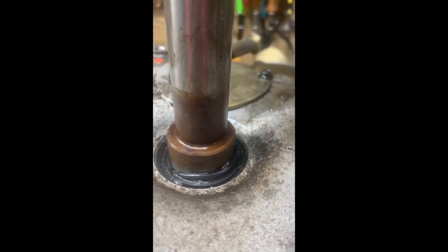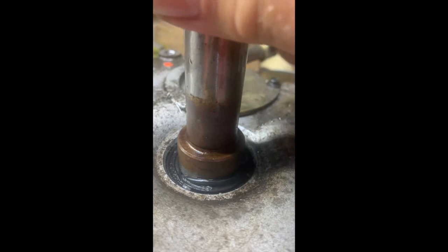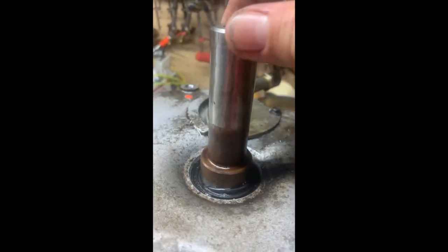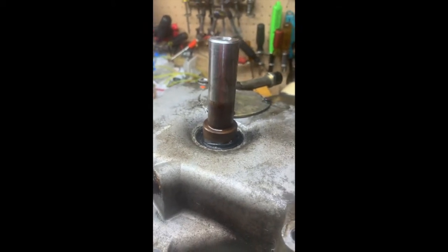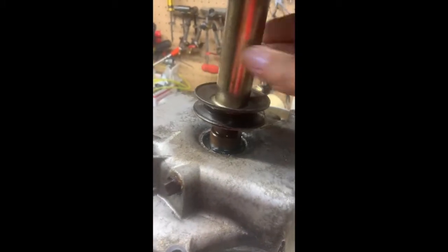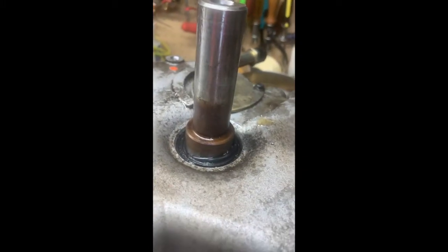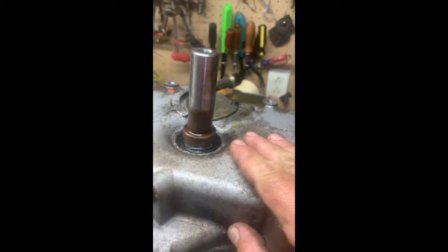When you put oil into your lawn tractor engine, there's an oil seal that goes around this shaft right here - this is called the crankshaft. The main pulley system goes on top of this crankshaft, and the pulley is what the belts go to when the mower is running. This pulley goes on top of the motor like this - there's a key on the shaft and it fits right to the engine. You can see this area is full of oil because it was leaking out of here. I'm going to pull the sump cover off.